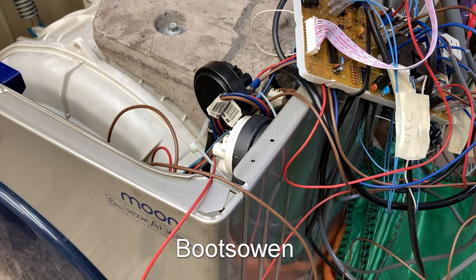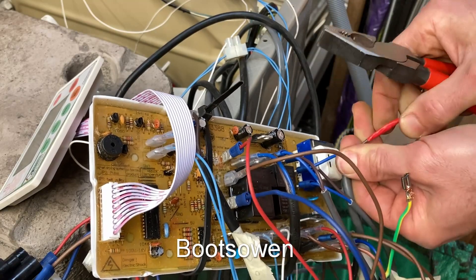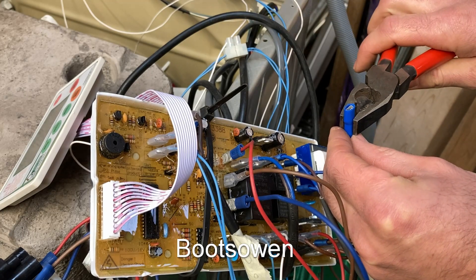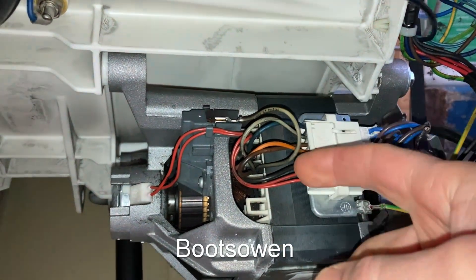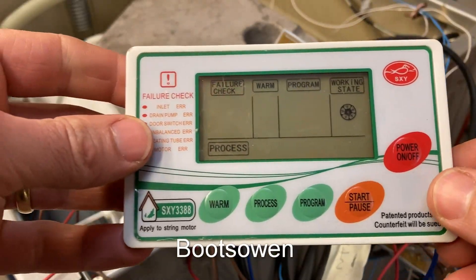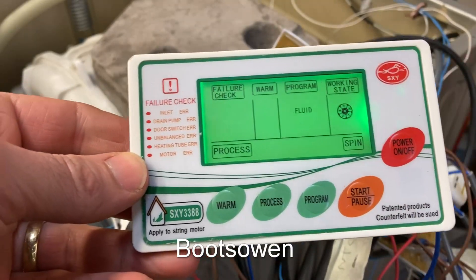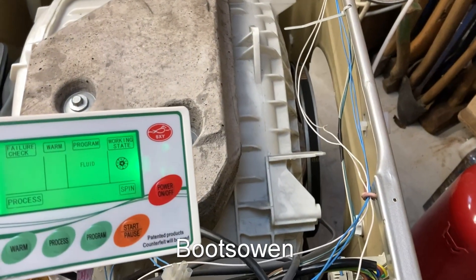So it's filled up and now we're getting a motor error. Even more messing around - swapping cables, pulling things around, thinking I had the stator windings incorrectly chosen. I'm under the machine and I've just noticed that a cable is off - that would have been from when I was deciding which ones were brushes or stator windings. I didn't put it back on. That might be the answer. Back up on top - with the motor back together, we're live. Process spin - it doesn't have a spin speed button. It'll depend on which winding I've used as to whether it'll go fast. Drain, door lock - yeah, it's pumping out.